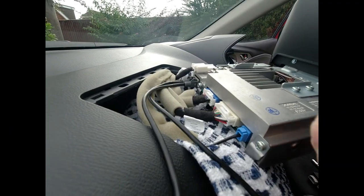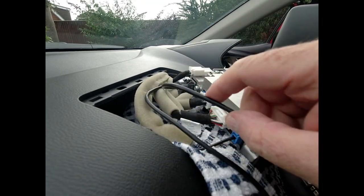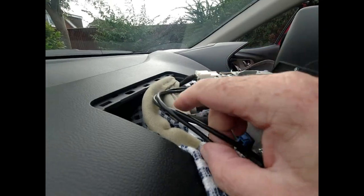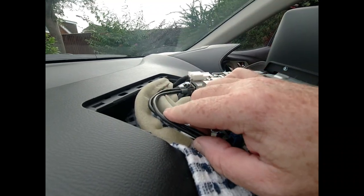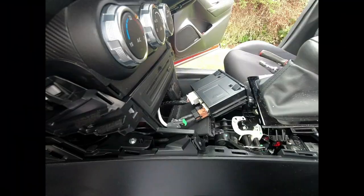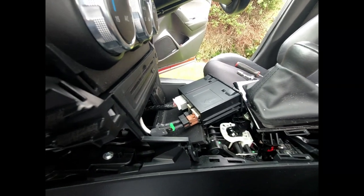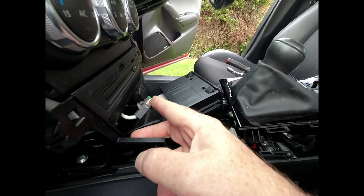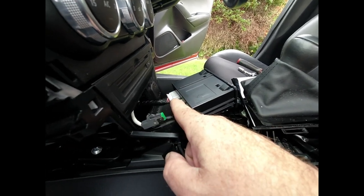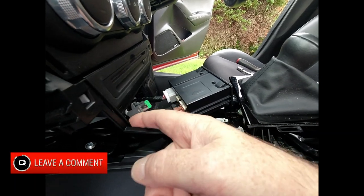According to the instructions, you have to unplug one connector of the original harness and replace it with another one, and there is also a separate harness. So we've now got two harnesses to tape up, insulate from rattling, and route down neatly — and in classic tradition they're going to be about six feet too long. We've got the cables all routed in loosely at the moment for a dry run before boxing it back up. There are two plugs into the back of the new unit. One plug doesn't appear to fit its socket, but if it's the same wire connected to the back of the display screen then it's redundant anyway.